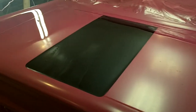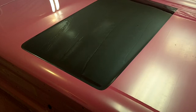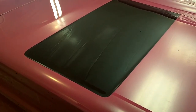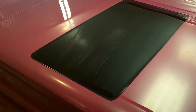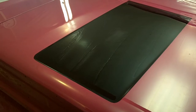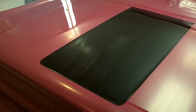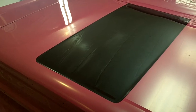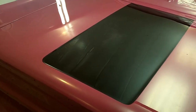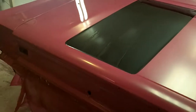Mike came in over the last few days and worked on the black stripe here on the trunk. We had some fuzziness around the edges from where the black paint bled up underneath the masking. Mike took some 1/16th-inch pin striping and put it around the edge of the black, sanded up to it, masked up to it, and then we shot a little more pink around the edge there. It really, really super cleaned up that stripe — that thing looks super sharp now.